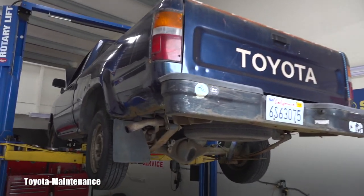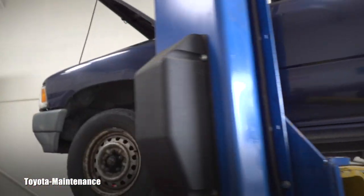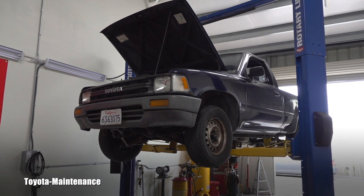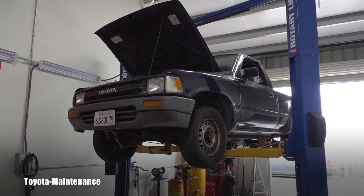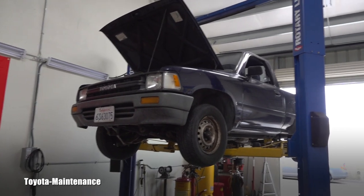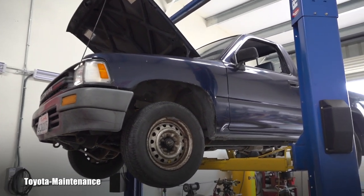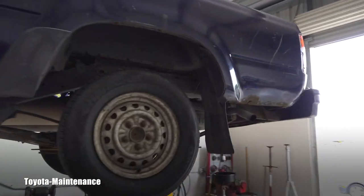When I got it to the shop for inspection and opened the hood, one of the things I saw was that the brake fluid was low, so I added it. It was also indicated on the dashboard — the brake warning light. After I added fluid, the warning light went off and everything seemed great. But obviously that brake fluid disappeared somewhere.